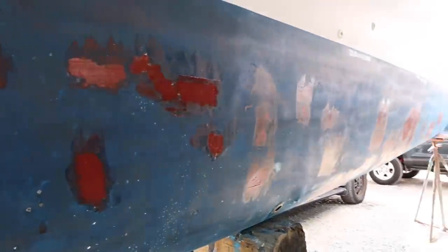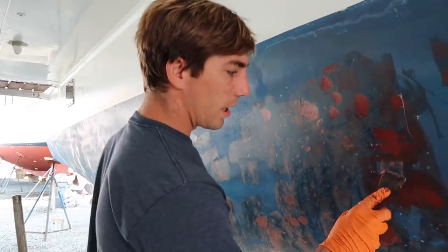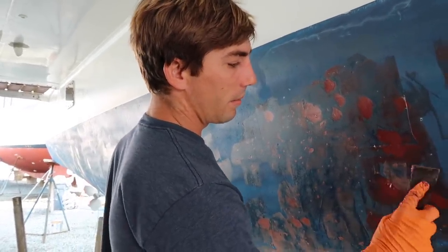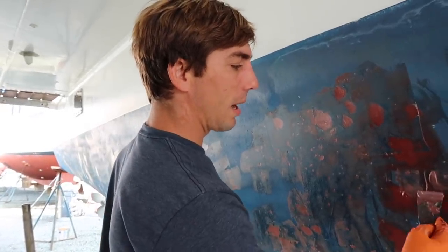It's bad on the inside of this hull; on the outside it's not that bad, and on the other hull there's almost none. We'll fair these, let it cure for a couple of days, sand it down, then put a primer layer and a barrier coat on all the areas where we did some fairing. Then we'll see on our next haul-out in a year or two — maybe shorter, maybe longer — what the hull looks like. Maybe we'll prepare then to do a full bottom job, because on a sailboat having your hull nice and fair with big long fairing boards really increases efficiency. We'll plan for that in the future, but for now, if you want to go sailing — just band-aiding it.